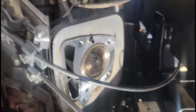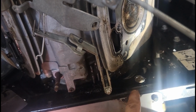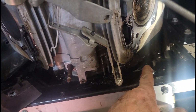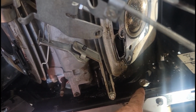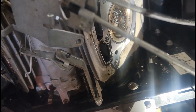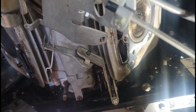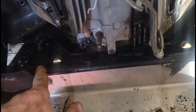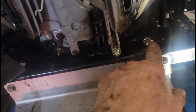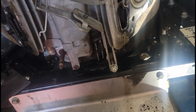Well, you saw we got the heads off. Talking about exhaust problems, trying to get that inside bolt out. I looked underneath there. I tried a combination wrench, open end wrench, 1/4-inch drive socket, shallow, 1/4-inch deep, 3/8 shallow, 3/8 deep. Nothing would fit up on that long stud. So I just cheated. I measured over, marked, and the frame rail, there's nothing in the way under there, and I drilled a hole so I can shove a socket straight up. I think that's a nice hack for this one, because when I go to put the muffler back on, I don't want to spend an hour doing it.